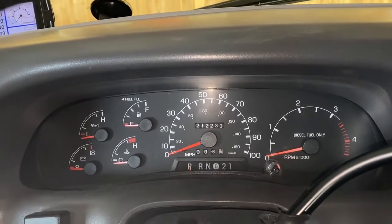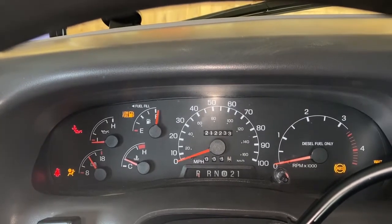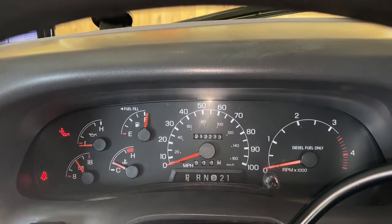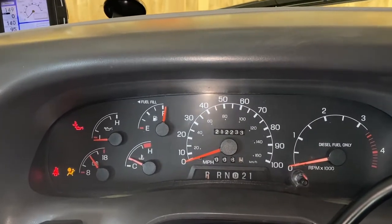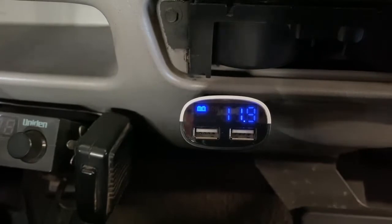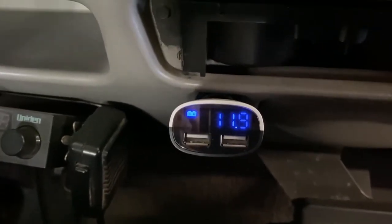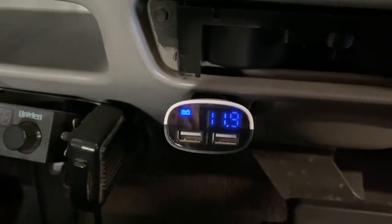This is our dash in the 212,000-mile truck. We've turned the key on and we have our voltmeter, but I do not see a battery light. That's some concern because we have key power at the alternator but no battery light in here, and those are tied together. Back at the dash voltmeter, it only reads 8 or 18 — there's no scale in between. That's why we sell these audible voltmeters, because these vehicles don't really have a great way to tell if they're charging.